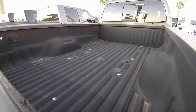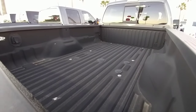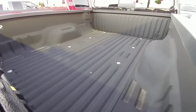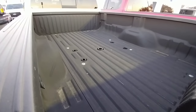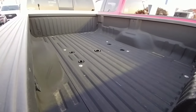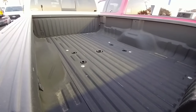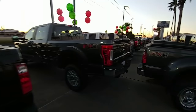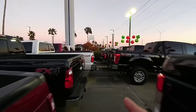Another reason people opt for an 8-foot bed versus a 6.5-foot bed is that when hauling a fifth wheel, it places the hitch further towards the back of the truck, giving you a much lower chance of making contact between the front of the fifth wheel and the back cab of the truck — versus a short bed truck where you don't have the additional space needed for clearance. When you opt for a 350, especially with an 8-foot bed, you're much more likely to get a hitch prep package already included. I highly recommend getting it — it saves you time, saves you money, and it's warrantied by the manufacturer. Most trucks do not include any type of hitch prep; only a few of the 350s with 8-foot beds and the duallys do.